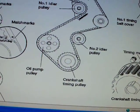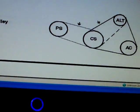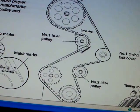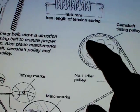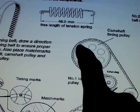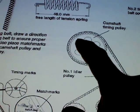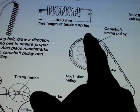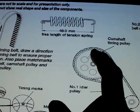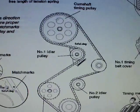The next problem is once you get the belt off, there's a hole right here, right about there. You have to get a little tiny piece of mirror — a small piece of mirror — and when you turn this you'll see a mark on the bearing cap; it's just a straight mark. You line that hole up so the hole is right on that line.